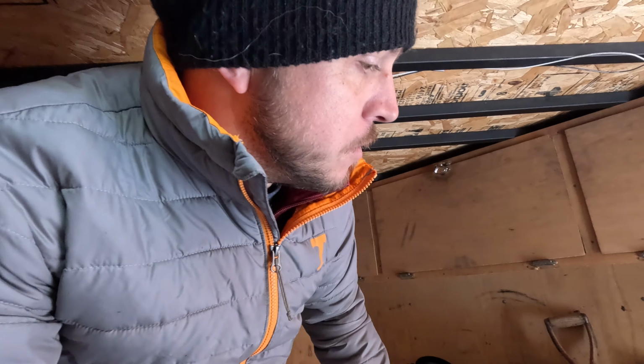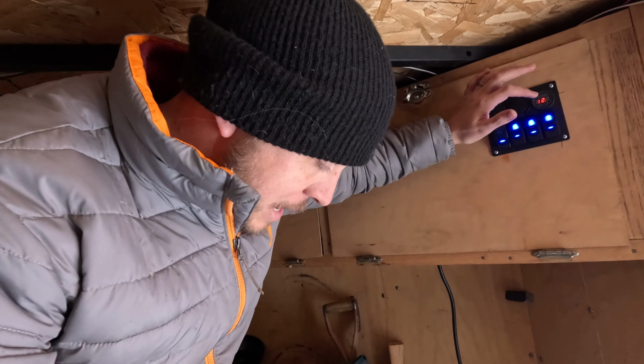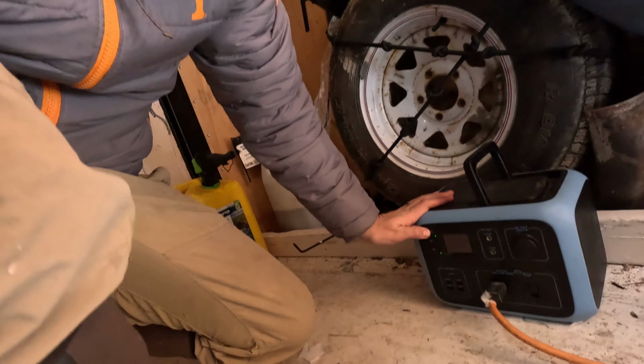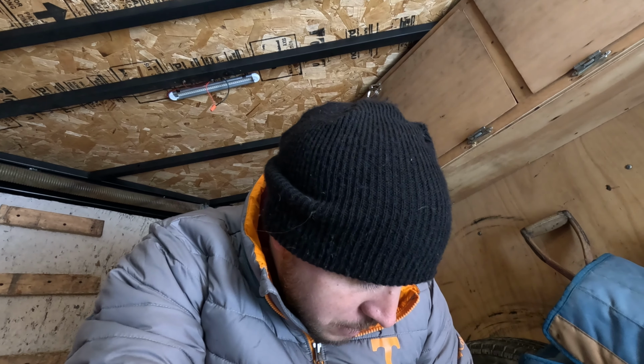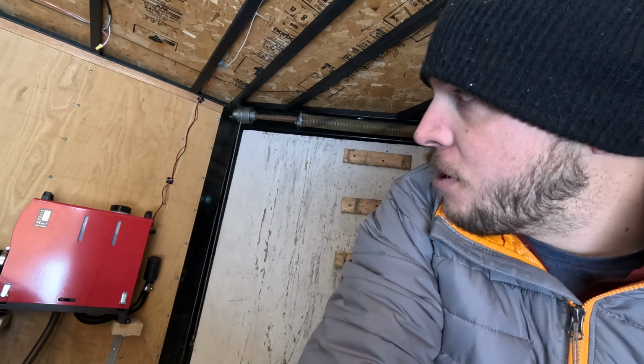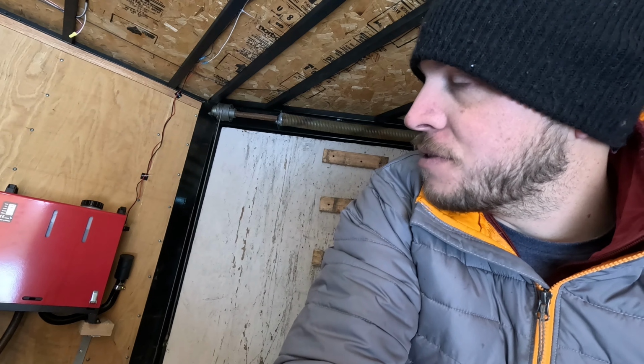So you'll notice over here, we've got some voltage drop, went from 12.6 to 12.4 volts. And our little power supply down here is reading 134 watts, which includes the lighting overhead. And the lighting overhead is about 24 of those watts. So, you know, peaking about 144 right now. And the ticking has started for the pump. So this guy is already kind of firing up and is in the process of doing that. And then I'm gonna go down to the next one in a little bit and we're gonna fire that one up as well.